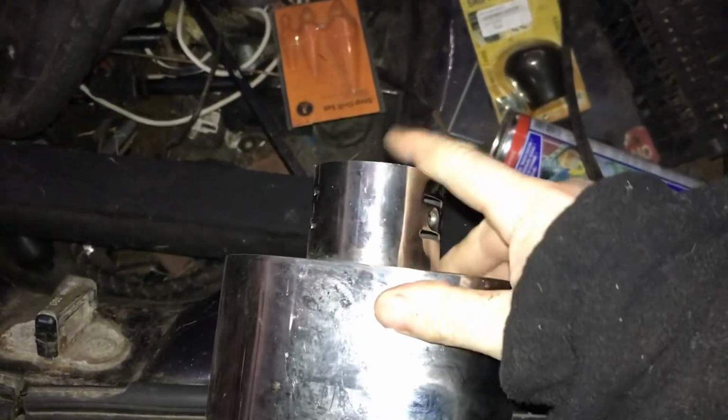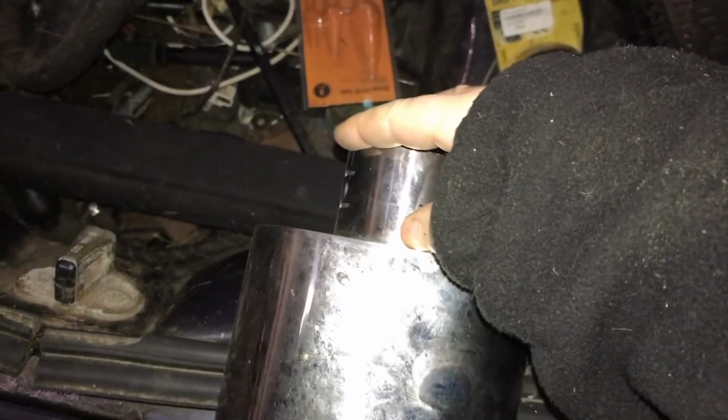You can see one there, and I actually have a second exhaust. So like the TT that has twin exhaust tips, I really want to have twin exhaust tips. So what I will be doing is not just mounting this, but my plan is to weld the pipe here at 90 degrees, join it onto the far tip at the other side, so they will be plumbed together, and I will have twin exhaust pipes in the back of this car.